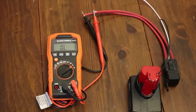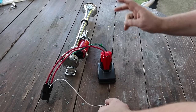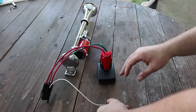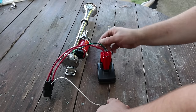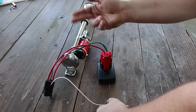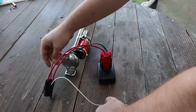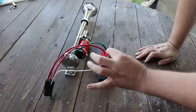That's exactly what we want — now we just need to hook the horn up to that. We moved our operation outside because my wife said this is not an inside horn, and maybe she has a point. We're just using a temporary battery for setup purposes — we're going to be installing it with the car battery. The grounds are hooked up and they're not active unless there's actually power running through, so those are good to go. You can have them hooked up all the time. One red is hooked up to the relay — it doesn't matter which one — and the other red is hooked up to the positive side of the compressor, with the ground already connected.